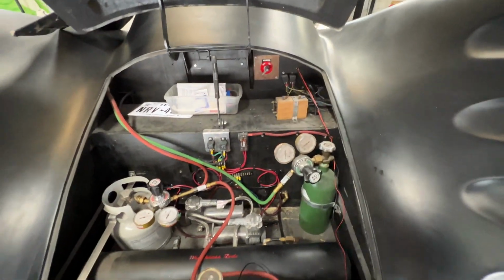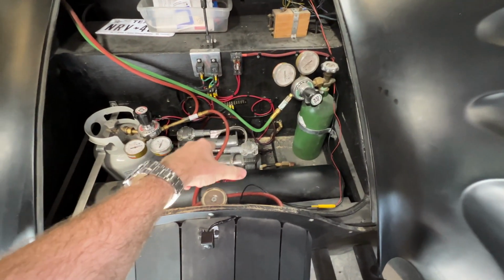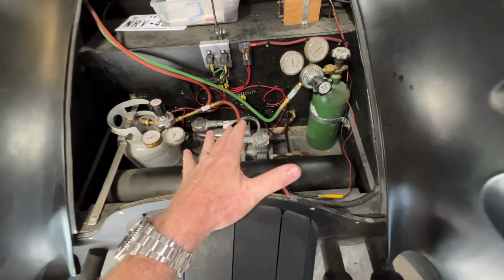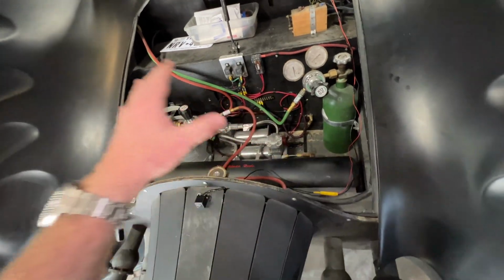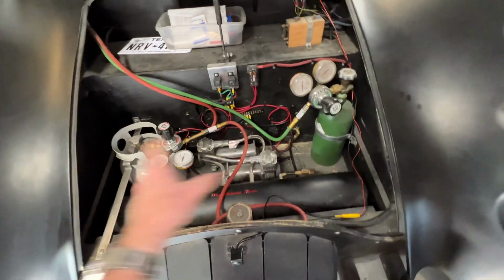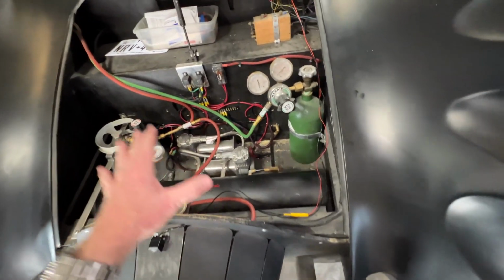So Jack, our technician, has rewired these air compressors so that they're working now. They were underwired. They had put 30 amp breakers on 40 amp units. We've rewired it so that they work from the switch. We have not fixed the propane and this stuff. We're not messing with that. I told them, just don't worry about it. We just need the air ride to work.